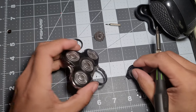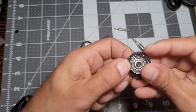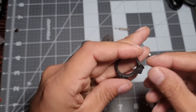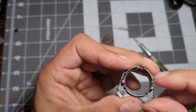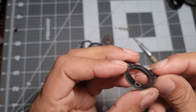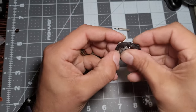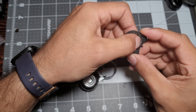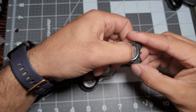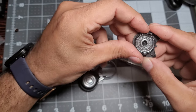We shot our spring — there it is. When you put it back together, you'll notice there's a flat side on both sides of the motor shaft. You have to make sure that is lined up perpendicular with the other flat sides. See that flat lip right here at the front? That's one. If you flip it over, there's also a flat lip on the back side — you have to make sure those flat lips are seated in there, otherwise your motor will be very annoying and rub. So we'll get that in there. I think we're in — all righty then.